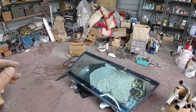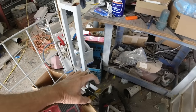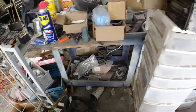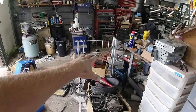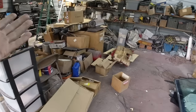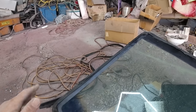How do the professionals do it? Professionals will not guarantee they won't crack a used windshield taking one out — most of them won't even do it. What they use is like a Sawzall tool that only moves a fraction, more or less vibrates, with a long thin putty knife-looking blade. The tool is like over $300, and then the putty knife blades are about $35 each and they're really thin to cut through the urethane. You could screw one up by going too far and hitting a metal edge. The tool I used was $65 bucks.